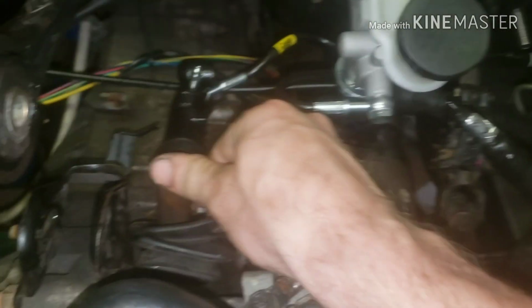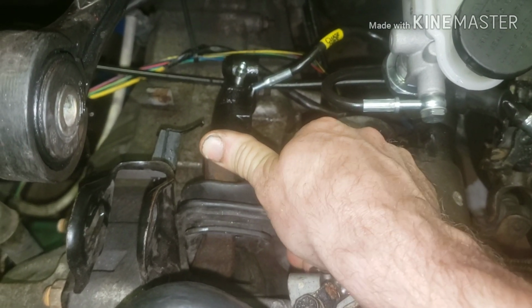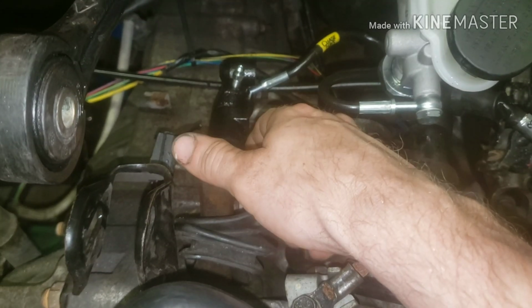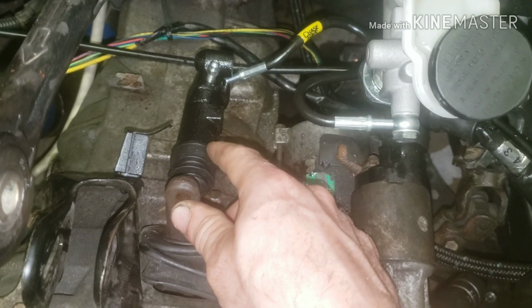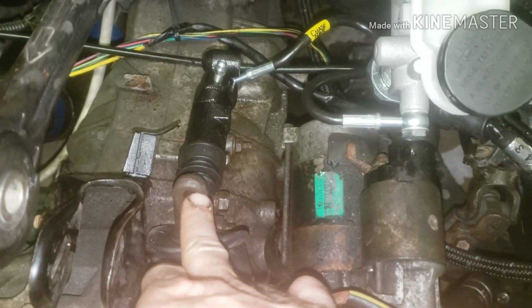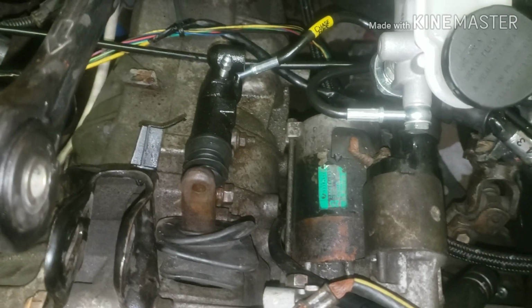seemed to work was to clamp the clutch rod all the way in, and then have the person pump it and then bleed it like typically. But for some reason, pushing the rod in helps. It just works a lot better than leaving it only using the force of the clutch spring, if that makes sense.